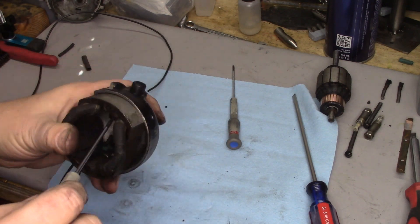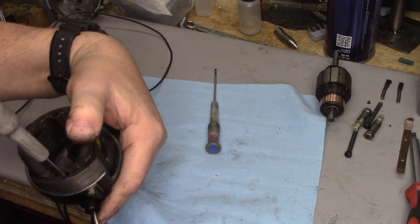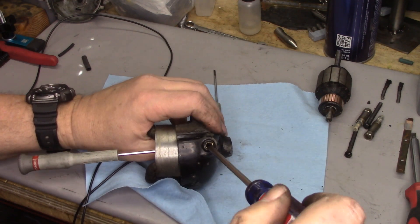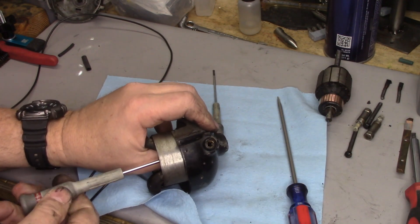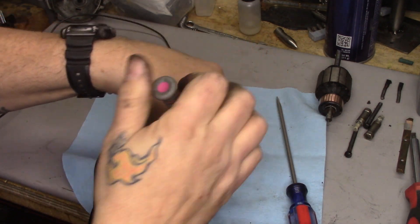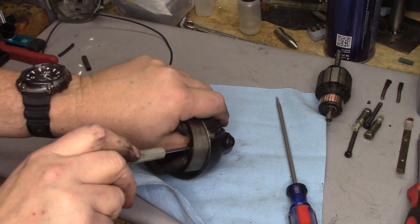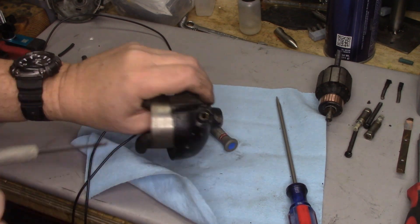That's not square — we've got to loosen that a little bit, then put our screwdriver in to square that up. We're going to use a pair of tweezers. There we go — we've got her squared up. Now we're just going to snug that. Reasonably squared. Now we've got those retracted and none of the wires feel like they're in a position where they're going to interfere with the commutators.